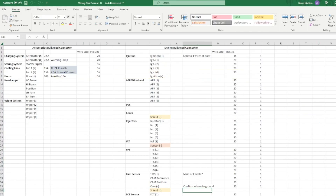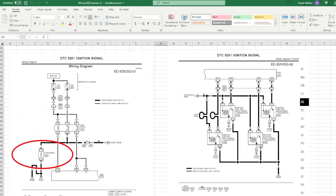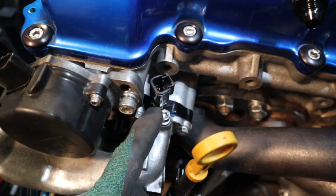If you're going to plan out your engine wiring harness, there are a couple things you need to do in advance. One is have a rough idea of what systems you need and where those systems are going to sit. Get your sensors installed and figure out the placement of all of them before you start making the wiring harness. Also make sure there's no other systems you're going to be adding — say extra hoses, oil catch cans — anything that could interfere with the wiring harness. When I plan out a harness I like to make sure it's tidy and kept away from those systems.